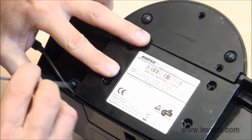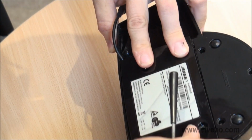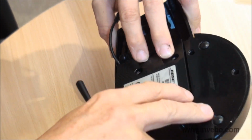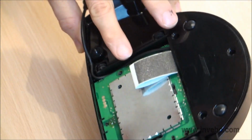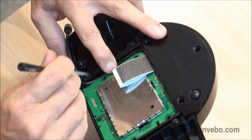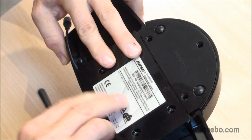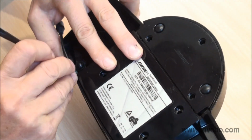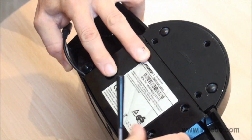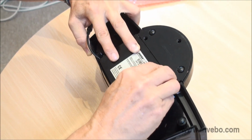and just ease the cable into the slot you've made. There you go. Now it's crept out at the top, so it can be a bit tricky. There you go, that's better. Drop the top in first, drop the bottom in first, get it into the slot you've made, and that's it there. So whilst you're holding that in position, you can just put your screws back in.